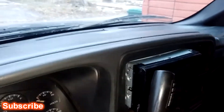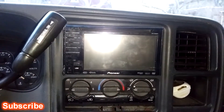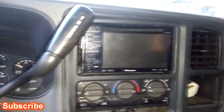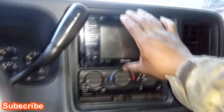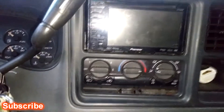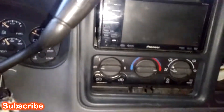So I got my radio in — as you see it's sticking out way far. I just put it in there so y'all can see. I don't use dash kits, I just put them in there, push it to where you need it to go. I'm gonna take some hot glue on this face plate and put it right on the edge here. Hot glue ain't gonna hurt nothing — you don't have to do all of that trimming.